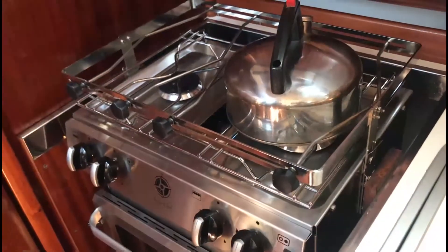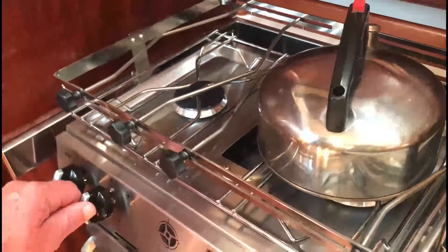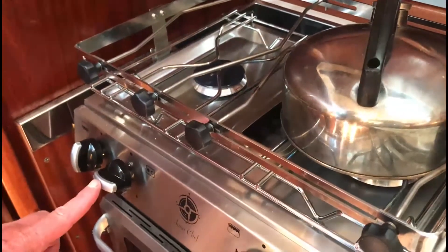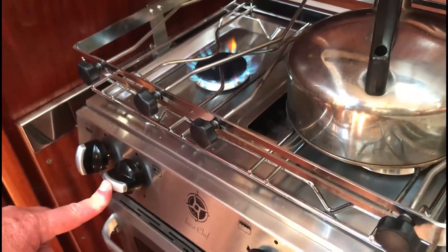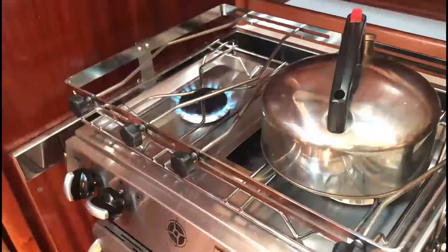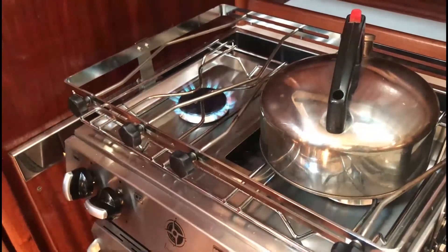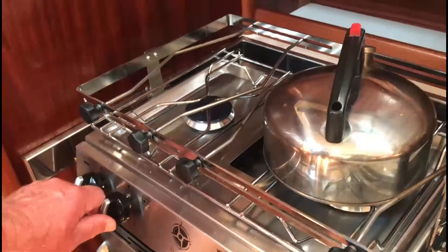The gas is on, so let's have a look at the cooker. We've got two top burners, an oven and grill. I'm going to get this top burner going — turn it on, push it in, light it and just hold it in for a few seconds and it'll hold. They've got flame failure devices on there, so if a gust of wind blew it out the little sensor would cool down and shut the machine down. You just need to hold the burner in to warm up that little sensor. Then turn it off, and remember to turn the gas off — get under here and whip the gas off. Job done.